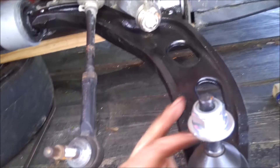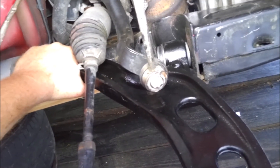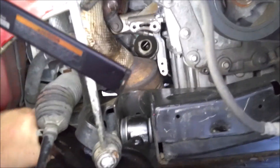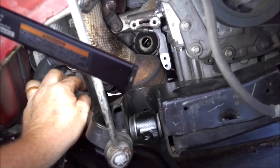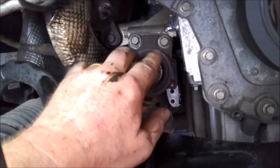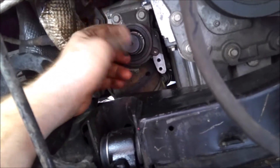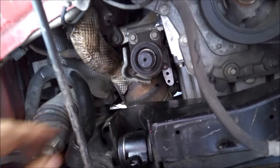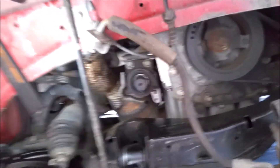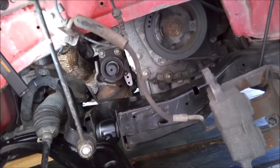I got the new control arm back in there - basically just put the one bolt through at 18 mil and your two over here, line up with the holes, start them, and tighten them down. I'm gonna go get the steering knuckle and the axle, put the half shaft into this bracket, and start putting everything back together. The two bolts for the axle bracket are 13 millimeter. Now we can get our steering knuckle and strut - I'll hang the strut from the top first to get it in place.